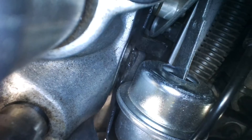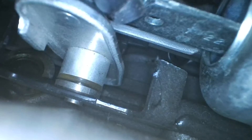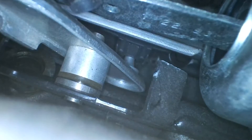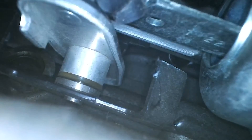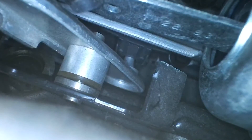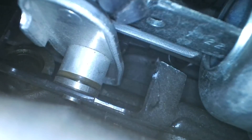I moved over to the other side, which is the passenger side. You can see when we energize the solenoid that it's only pulling halfway in through the actuator. I can't tell if it's mechanical — it looks like a piece of tubing is blocking it, or if it's just a weak actuator. So it's something we're going to have to investigate.